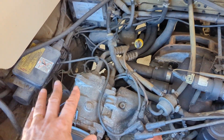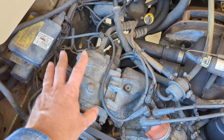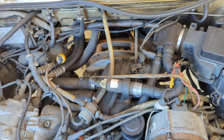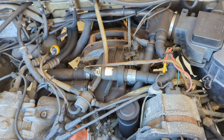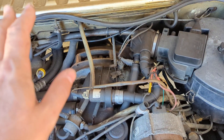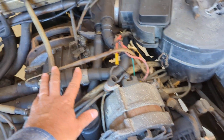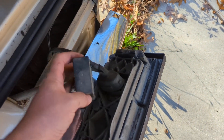That's why it has its own little control box to look at these different sensors: the power steering switch, the temp sensor, and the throttle switch. It also has an input for the air conditioning — when you turn on your A/C, it's going to raise your idle a little bit to keep the engine from stalling when you're at a light or taking off. So what if this thing doesn't hum or buzz? In my experience, the problem is most likely with the idle control unit.